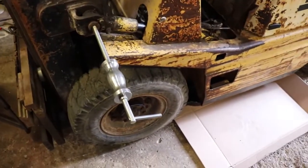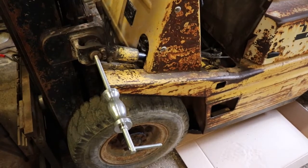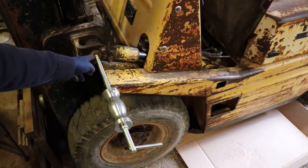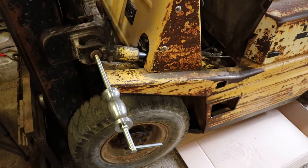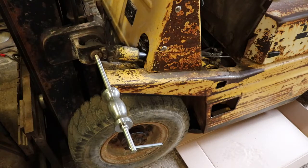There are two pins holding in the hydraulic cylinder. I've got a slide hammer for drawing the pin out. You could probably get it out without a slide hammer, it'd just be harder. Then it's 14 millimeter heads for the keepers and 19 millimeter for the hydraulic fittings.